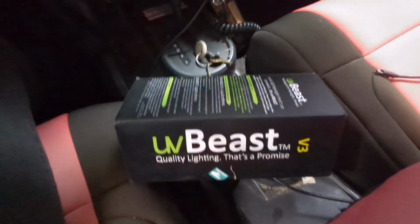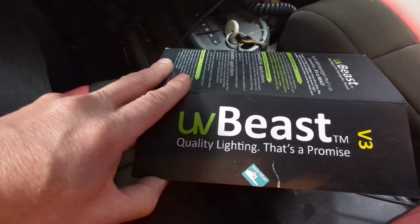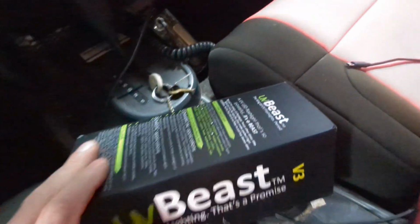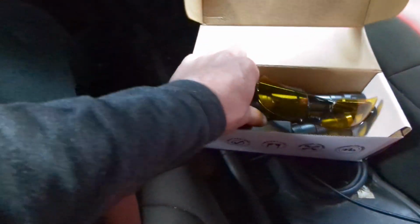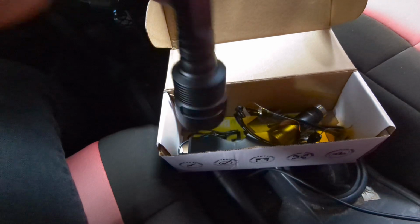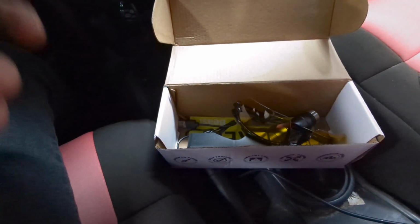All right, so a lot of AC systems from the factory will come with UV dye in them. So I got this pretty bad UV light that we're going to be checking this AC system with. What is it? The UV Beast V3. Grab this on Amazon. And if there's a leak, you're definitely going to find it with this thing, as long as the system has UV dye in it. I'll leave a link below where you can grab these on Amazon. But first, I'll show you how to tell if there's dye in the system to begin with.